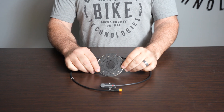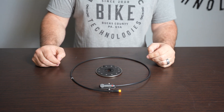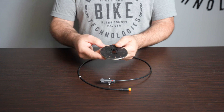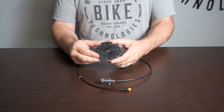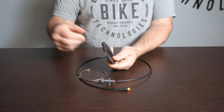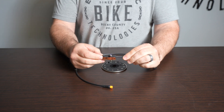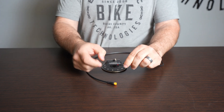We also have the 12-magnet split disc with retaining ring, which comes standard with all e-bike kits and e-tri kits, non-specialty kits, as well as Baja kits, Easy Tri Classic kits, tandem kits, and traditional kits. On the magnet, on some installs it might be necessary to take off these fins and modify it a little bit, but in most cases you just take the ring off, put this on the crank, and put the retaining clip back on. With the sensor, sometimes a little modification is necessary — we have this swivel clip that comes in handy, but you might not need it, so it's perfectly fine to cut these little tabs off so it'll lay flat and you can just zip tie it to the frame.